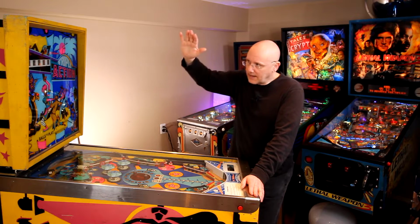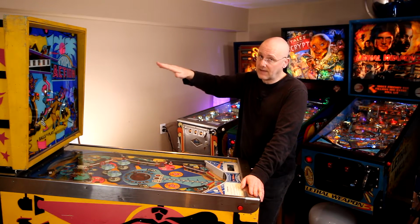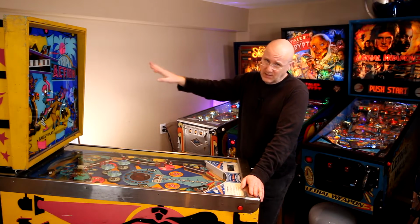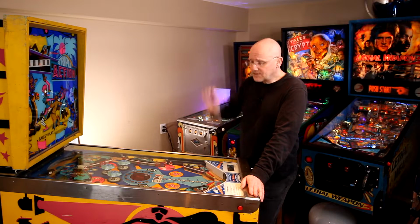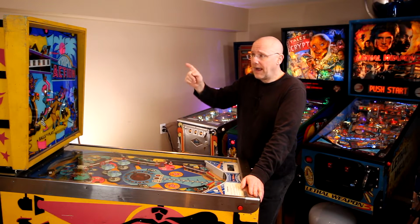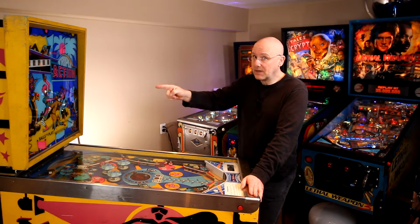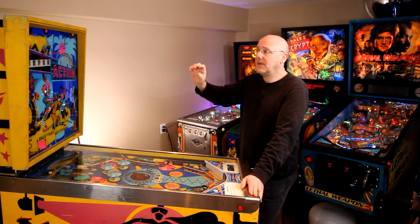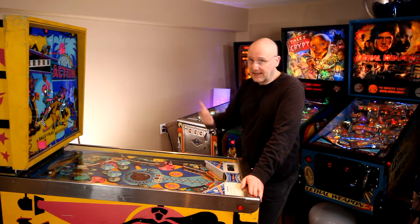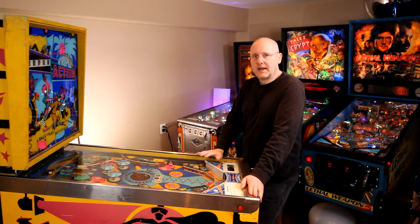So usually one of the first things I do, if I go to start a machine and the motor just spins and spins and spins, is turn the machine off. I will set all of the reels up to a different value. So, just set them all at 2 or something, all at 3 or something. Start the machine and see if they want to reset. And if one of them sticks and doesn't move, that's a good place to start. If one of them just sort of cycles over and over again, that's a place to start. That's usually my process for digging into these things.